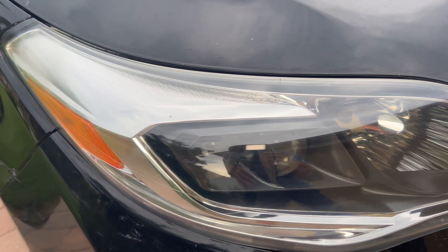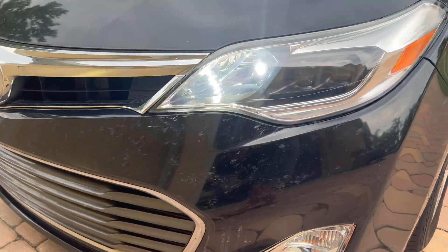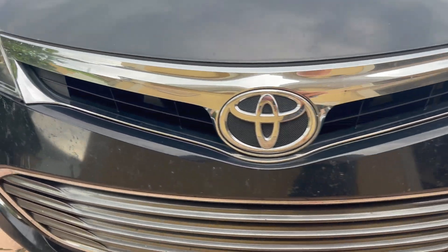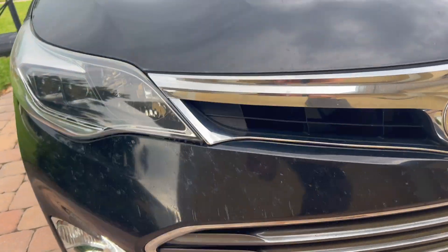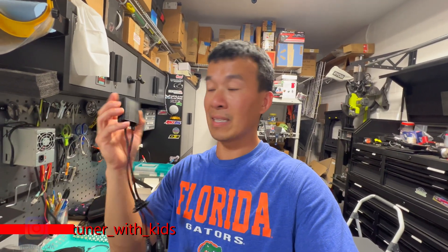With the new LED bulbs on the low beam, everything's working perfectly fine, but on the high beam I put in LED bulbs. This is one of the Avalons that uses the high beam as a DRL, and a lot of Toyotas from this era used that same setup. If you put in new LEDs on that spot, it's going to be flashing. So in today's video, we're going to be adding this little canceler right here that's going to eliminate or reduce some of that flickering so the light looks more consistent.